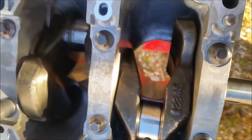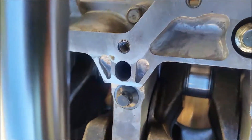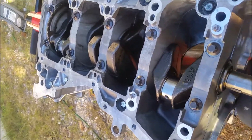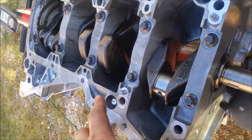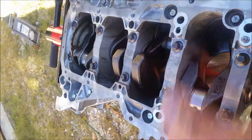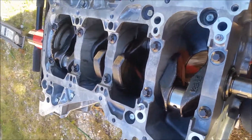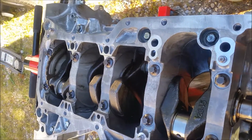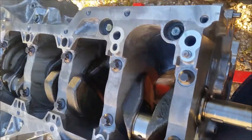I'm going to do that to all the bolts in the proper sequence. These are all torqued down. The third sequence is 18 pounds on these outside bolts, and there's a pattern to them as well — you look in the manual to tell you what the pattern is.